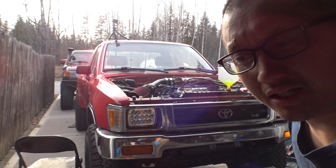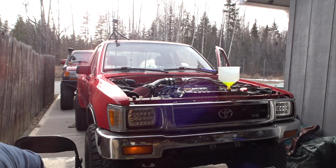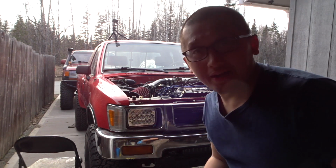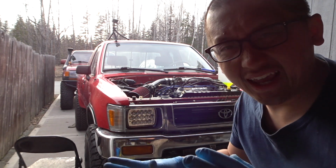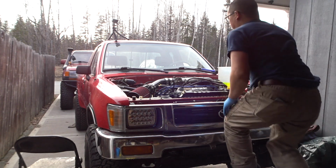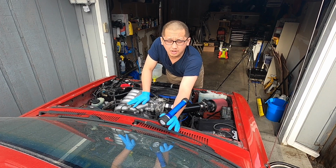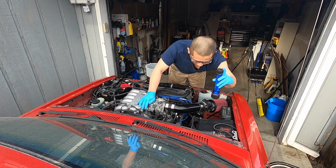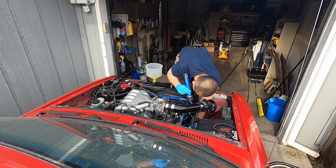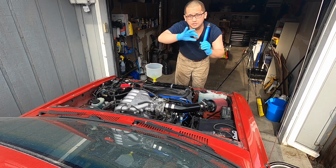Down a little bit, but it's still around like 1,000. It needs to be lower. Just checking my lights. My LED headlights, I'm still waiting for the harness. Right now it's idling around 1,000, which is good. 800, most likely around 800, 900 is good, but 1,000 is doable. Very good. All that smoke from earlier was on the downpipe. I sprayed some PB Blaster on it the other day. Gonna go ahead and bleed the power steering, just turning your wheels left to right.